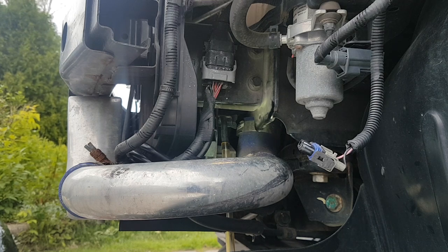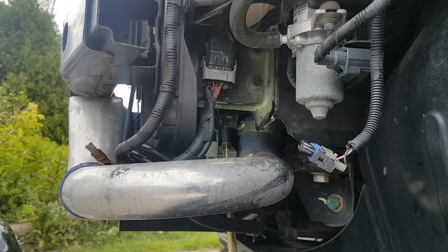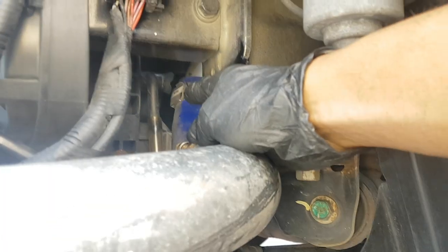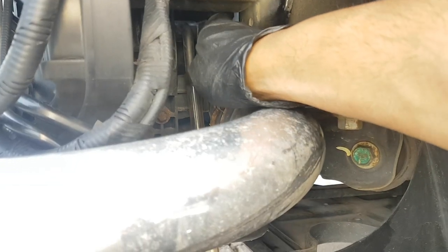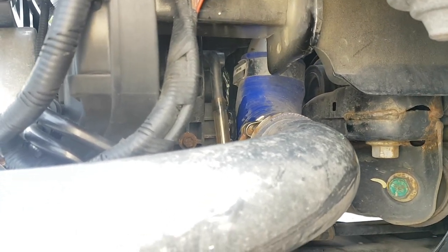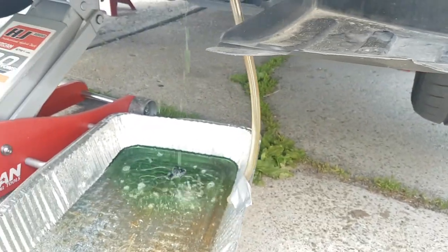So now I'm going to attempt to drain it. All I'm going to do is put my hand in there and turn it counterclockwise to the left. I got to loosen just a little bit — it's a quarter turn. So the coolant comes out like that. I thought it would come out through this pipe. Okay, that's going to be pretty messy. That's coming out nice and green. See how it's splashing all over the place.